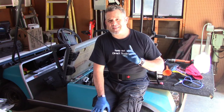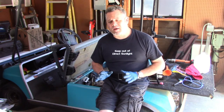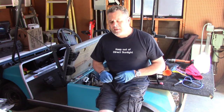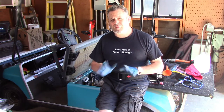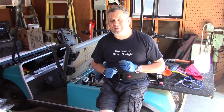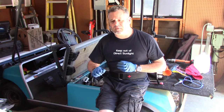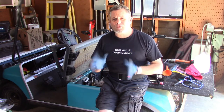electrochemist friend Jessica says, the happy flow of electrons in your vehicle. You want to stop the happy flow of electrons or your battery will die. It'll deplete just sitting there. So unless you're unhooking your battery from the negative side somehow and preventing your battery from depleting, what you often might find with your project vehicle is you come, it's been a couple of months, you want to start it up and it just clicks and nothing happens because the battery is totally dead.